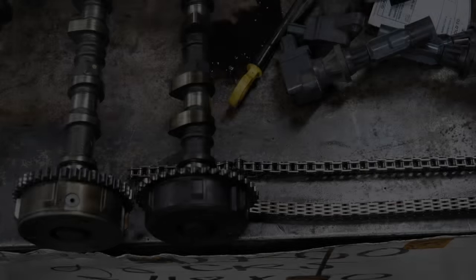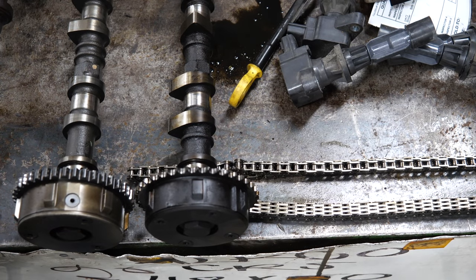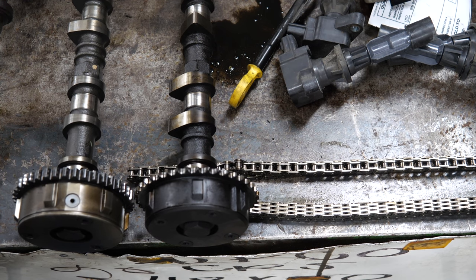This is a comparison I've been waiting to do — we're going to compare the 2.0-liter Ford EcoBoost and the 2.3-liter Mazda MZR, the engine I just tore down. I did an EcoBoost teardown a couple of weeks ago. I wanted to compare the timing components because that's a very sore subject for the 2.3-liter Mazda turbo variant. The turbo versions have notorious problems with the timing chain — chain stretching, VVT actuators going bad, lots of timing jobs at the dealership.